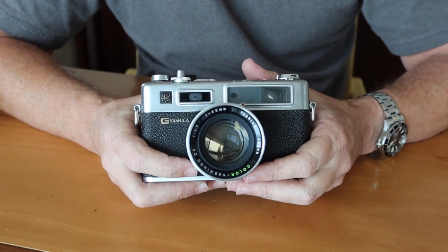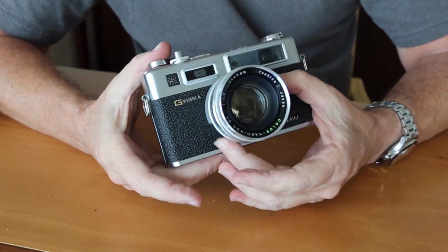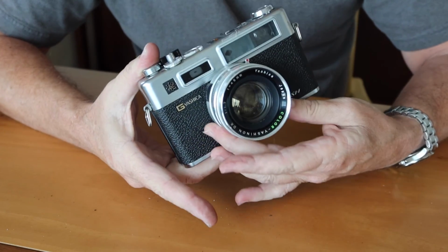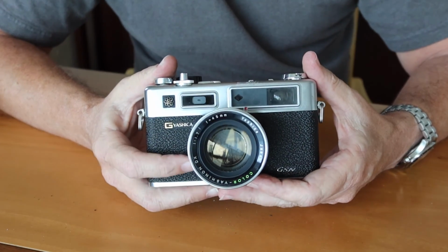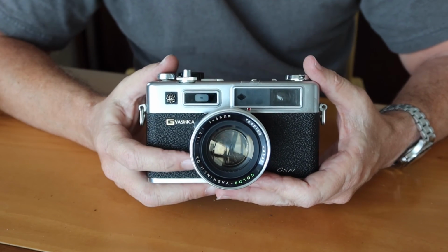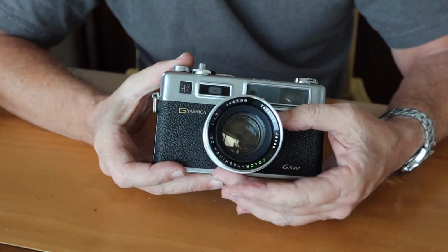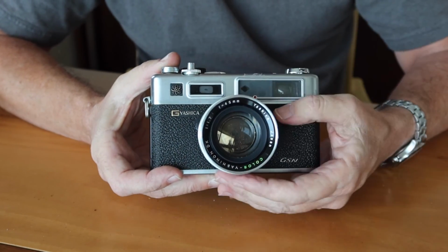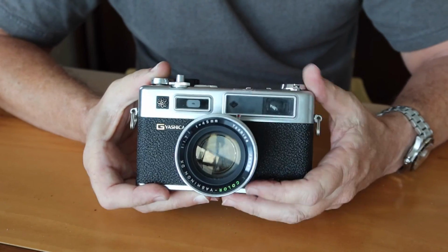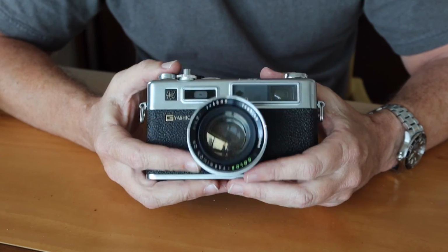The cameras which I sell, I always make sure that it's replaced. Another issue these cameras sometimes have is the focusing helicoid can become stuck. That's a common problem with these old cameras. You can usually fix this most times by heating up the camera with a hairdryer till it's really hot, and that kind of softens the lubricant and allows you to turn the focusing ring and get whatever debris was inside out of the way. And if you don't have access to a hairdryer, just sit it in the sun for a couple of hours on a hot day and that will do the same thing.